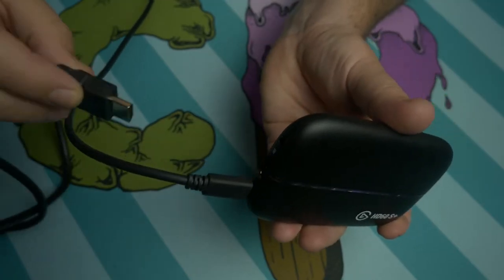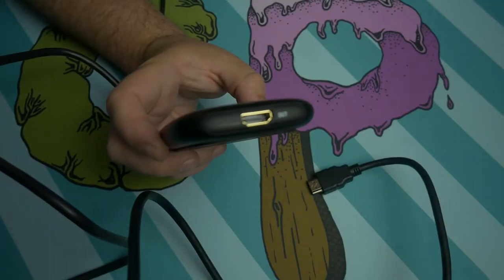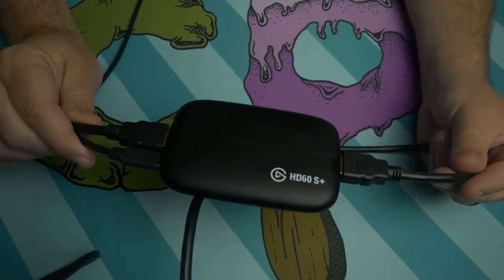To hook this up, all you do is connect your PlayStation or Xbox like you normally would. Take the HDMI going out of your console, normally to the TV, and plug that into the IN port of the Elgato device. To pass through, take the OUT HDMI port of your Elgato device and run HDMI out into your TV or monitor — that's going to pass through your signal. These devices do nothing to the signal chain and introduce no lag whatsoever, so you should see no difference having this in your setup while playing your games.